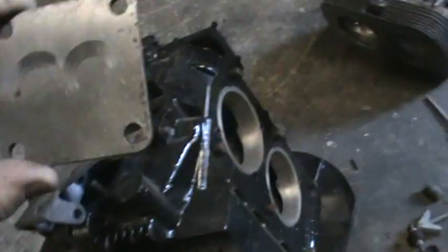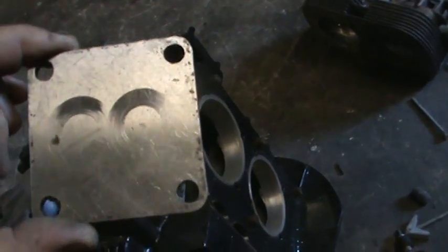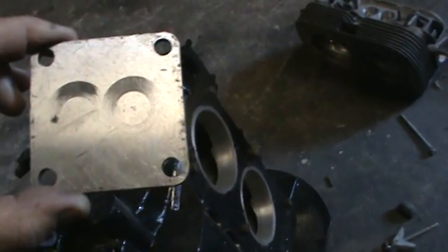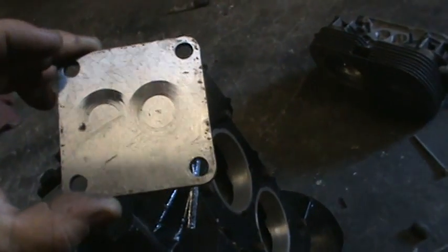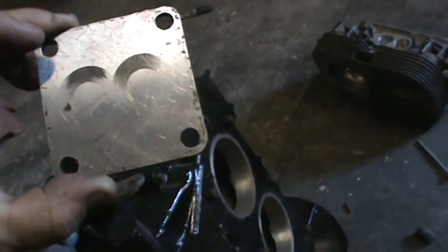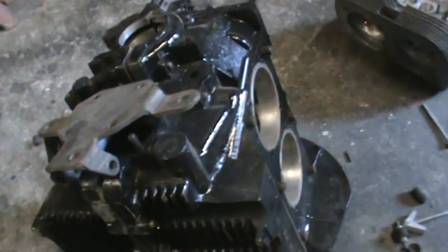It's a great idea in theory, but the pump is not made to support the weight of the motor. You can see where the weight of the motor has pushed this cover into the oil pump gears — that's the scarring you see right there, and that's typically what you see when you pull one of these off. Unless you make provisions to clearance the oil pump gears, anytime you shorten the gears it makes less pressure. Your clearance gets larger between the cover and the pump gears and your pressure decreases. You can seize the pump up and cause the motor to seize up from the pump stopping working. It'll actually grab the gear and spin the gear on the shaft — those gears are just pressed on those shafts, not welded. So if enough heat gets in and the gear stops against something, the shaft will turn and the gear will just sit there. I take those off a lot and find the same problem every time with the oil pumps — the pump stops working and the motor blows up.